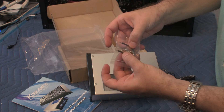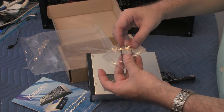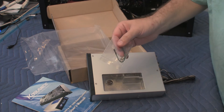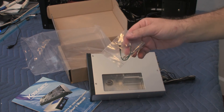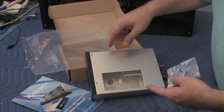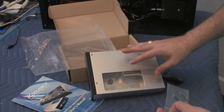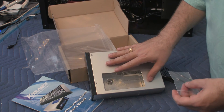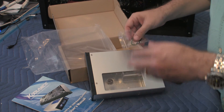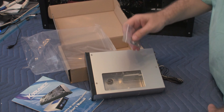This particular connector, you attach to two specific ports on the motherboard, and it will make the motherboard appear to be on to the power supply. The purpose of this is so that you can run the unit and have all of the water flowing through the system without the computer physically on. This is very important the very first time you turn this unit on — it will ensure that all of the water flowing through the computer is actually flowing perfectly, and you don't have any leaks. That's the last thing you want, is to have water leaks while your computer is on.